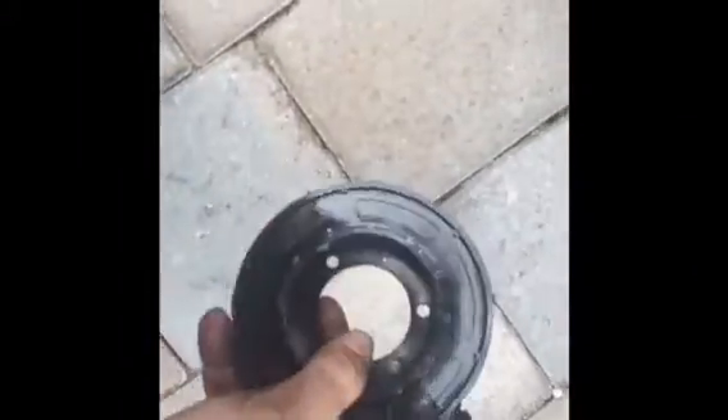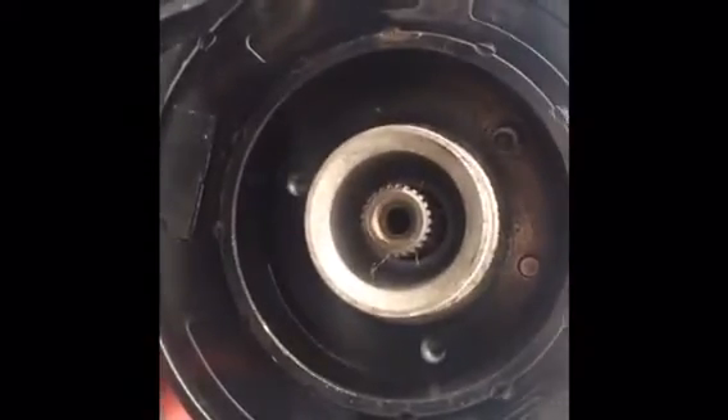This here is the good one. Since you have the flexible hoses you can pull the compressor out. Now I'm going to put this new clutch coil on — it goes on with three Phillips head screws right there. Once you put that on, you're going to have to tap this pulley back on, put the snap ring on, then fit the clutch coil and put the screw in, put your compressor back in, and check it out.